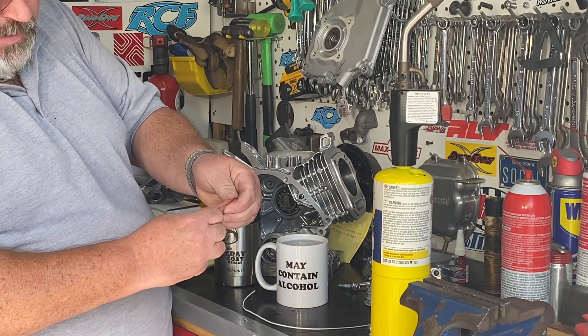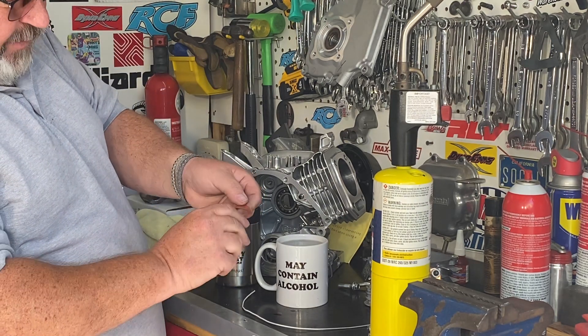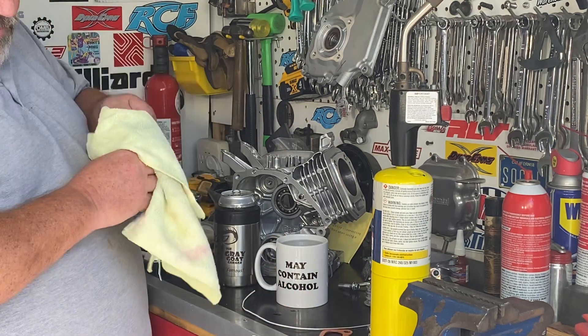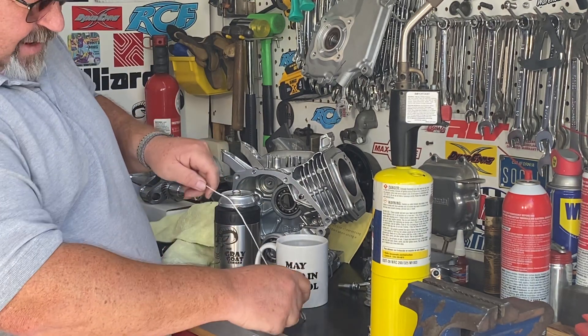Before we use them — if you don't do this, it's not going to seal right. The annealing process is going to soften up this gasket and allow you to use it where it's going to make a seal. It's also fun to watch as you're seeing all the different colors that happen. So I think we ought to do that again.